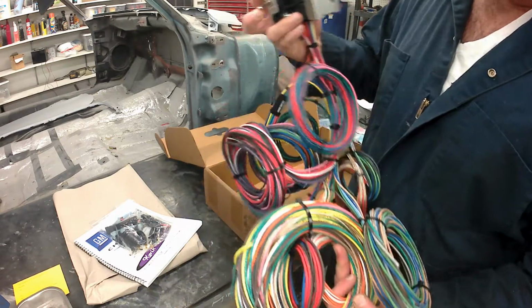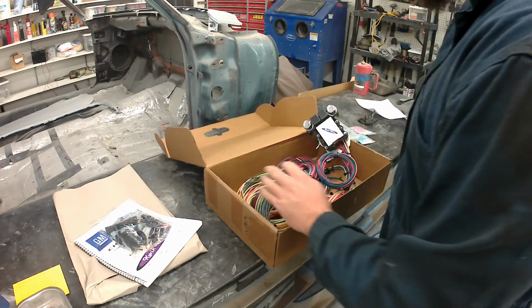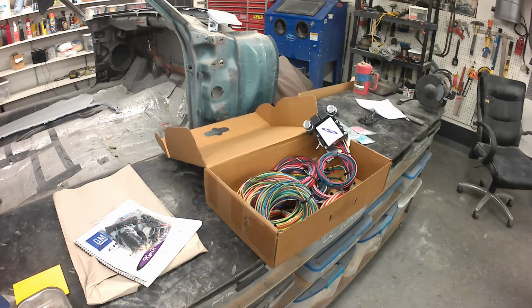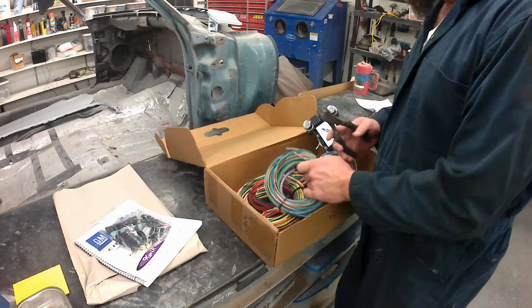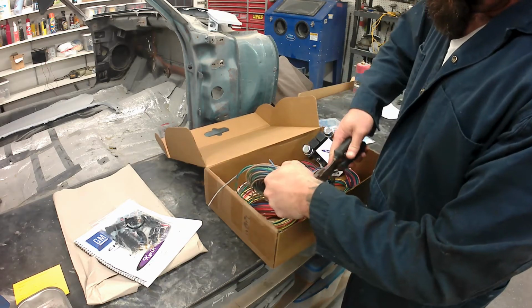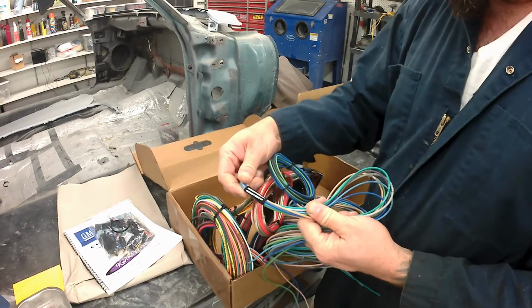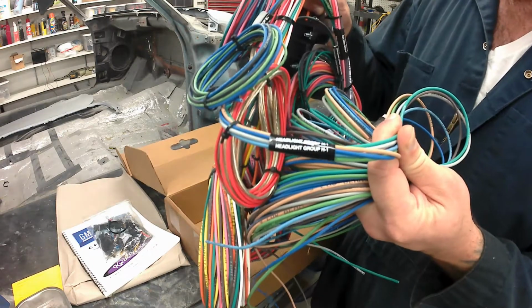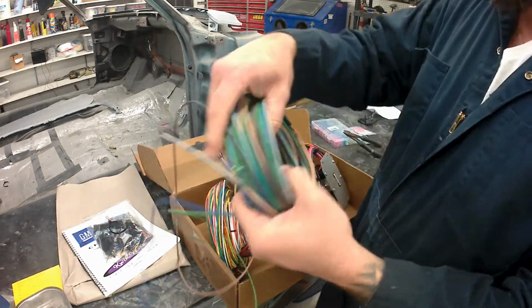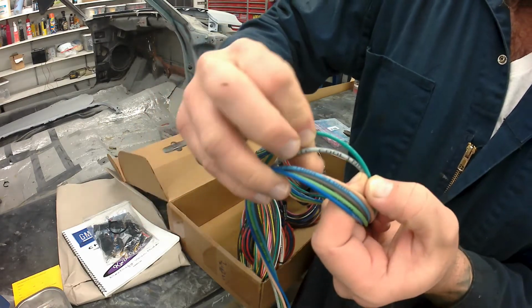You see the switch on the left there? That is a theft deterring disconnect switch, which I probably shouldn't be showing off on YouTube, but hell, it's on their website. And you can remote locate that anywhere. You can leave it on the fuse box, whatever you want, and it basically disconnects the power to the ignition coil. So when you turn the car over, say you got a thief in there, he's able to turn the car over like it's going and going and going, but he doesn't know why it won't start, rather than turning the key or shorting it out so that you can get the car to turn over and start, and nothing happens. Then the thief automatically knows that quite obviously you have a hidden switch somewhere, which they will try to find. Maybe, I don't know, seems like a lot of work to me, but if you got a nice car and it's worth several $1,000s, then it's something to think about.